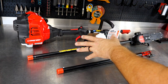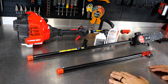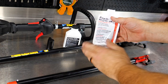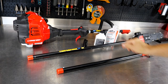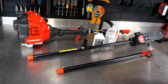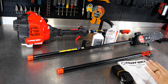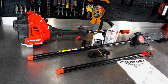It's the 25cc gas-powered pole saw. Specifically, it is a two-stroke or two-cycle, so it is going to require two-cycle oil mixed with fuel at a 40 to 1 ratio. It comes with this little pack here that's ready to put 3.2 ounces into a full gallon of fuel to have the proper mix ratio. You also get bar and chain oil. When we look at the business end of this pole saw, we'll see we have a tank for the bar and chain. When you get this kit, basically everything you see here is what comes in the box — with the manual, this little Allen wrench, and even this strap here. All of these things come in the box.